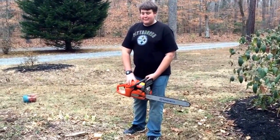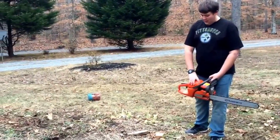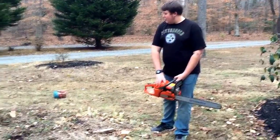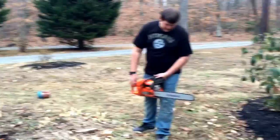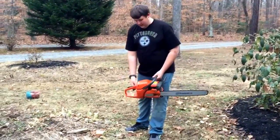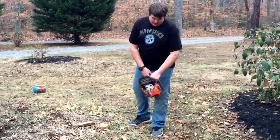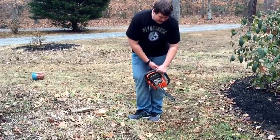So you pump your gas a bunch because you're pulling into that new filter. You hear it spitting air. Okay, decompression. Choke. Alright, I'm going to start it this way. I don't know if y'all are going to be happy with it, but whatever. Nobody's happy with how anybody starts a chainsaw.